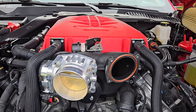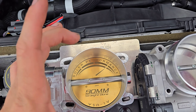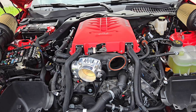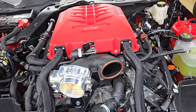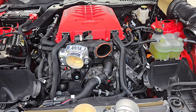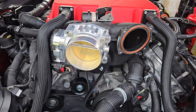This is their billet 90-millimeter ported throttle body setup. Compared to the 87-millimeter stock setup, it's a significantly larger bore for air to flow through. We've been working with them over a couple of months to get these mocked up and fitted, because of how close the throttle bodies sit. We had to come up with ways to mount them so they would not interfere with each other. With the Roush they're a bit further separated, but these will work for both the boosted and naturally aspirated setups.